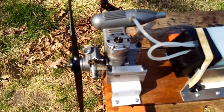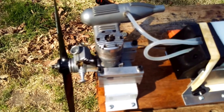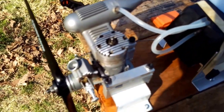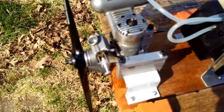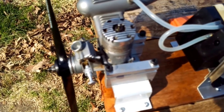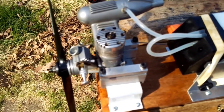It has a brand new piston ring from Mecoa. I did rehone the cylinder by hand using a medium grain brake hone. I basically honed it enough to take the lip off of the top of the cylinder. That's basically formed where the ring travels, and you kind of wear away the cylinder. I put some crosshatch in it, and I also went over it with 400 grit sandpaper to kind of smooth it out.